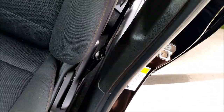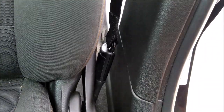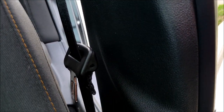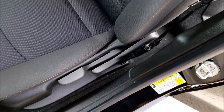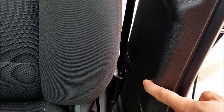After you get that panel out, all you have to do with the B pillar is pull from the very bottom outwards — pull it out towards the seat, and there's a set of four clips: one here, one there, and then two up here. It's going to come out. From there, all you do is push back in and put it back together. Shortly after this I will show you where to find the wires. The passenger side is done the exact same way and will be found inside of that panel.